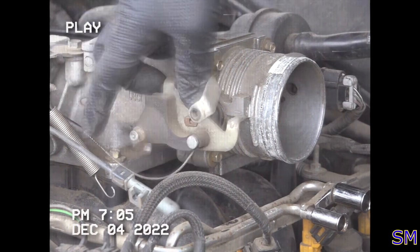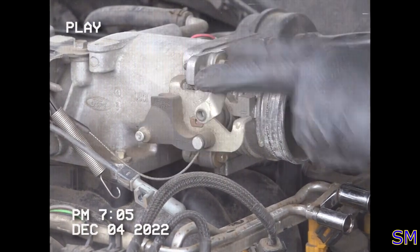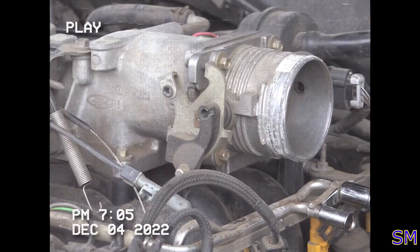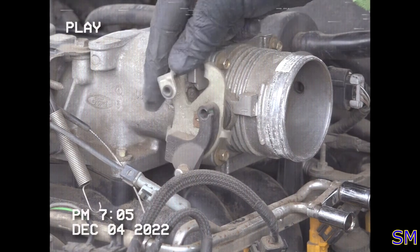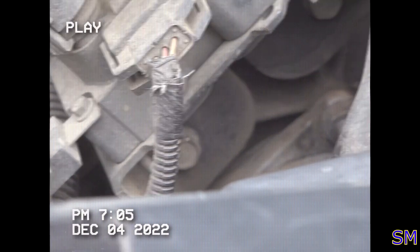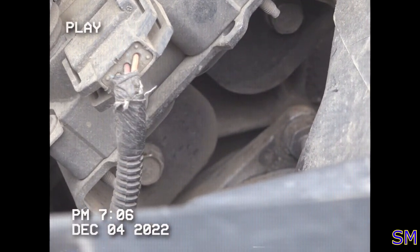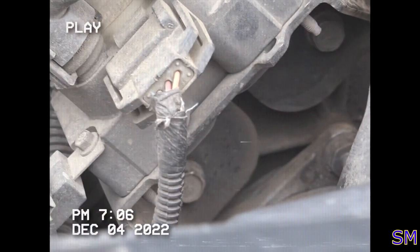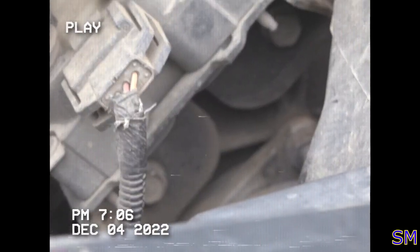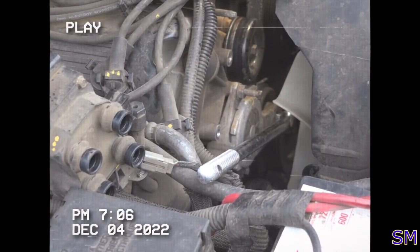That is bizarre. Undoing these cables is really easy for the throttle control. You simply go wide open throttle. Undo. Don't slam this back. That bore is very precise. Don't be slamming that around. It's a very precisioned piece of instrumentation. So there are two bolts. I retain it. There are two 13 bolts. Where am I at? Oh, actually, I need to manual focus. Let's try this all over again.